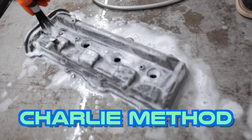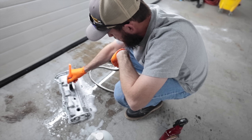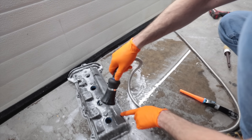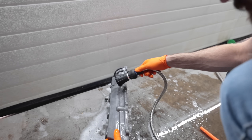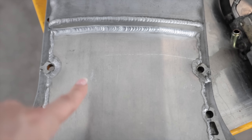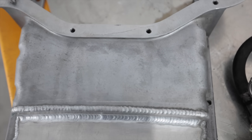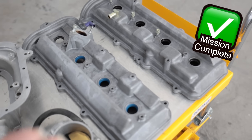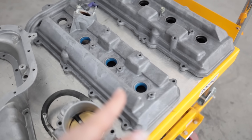See, that's what the muriatic acid did, but it turned it gray. Is that the gray one? Yeah, this is the dark gray one — that's from the muriatic acid, and I also sanded that with steel wool. Just for the sake of comparison, this section of the oil pan — the original portion up here — see how it has that marbling effect because it's made out of cast aluminum? It matches the valve covers. So that's OE. That's an OE finish. I think I need to realize that's what it should look like.